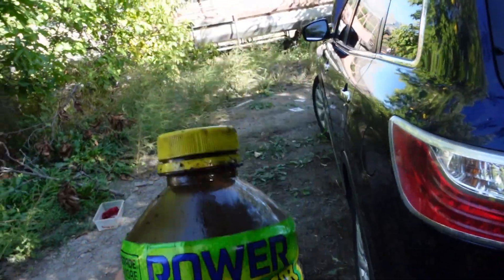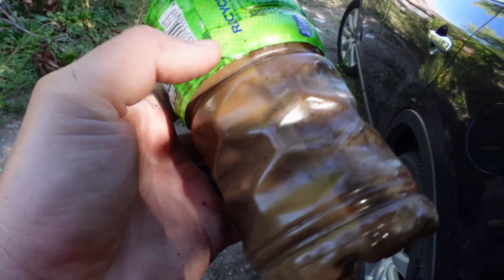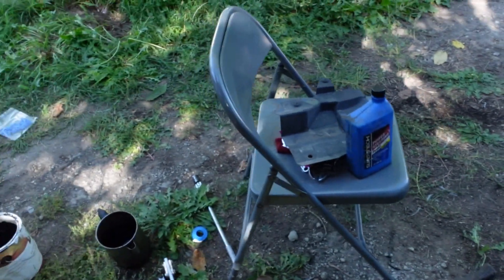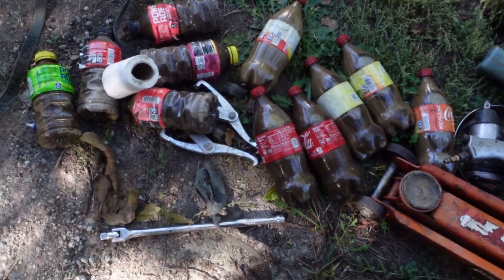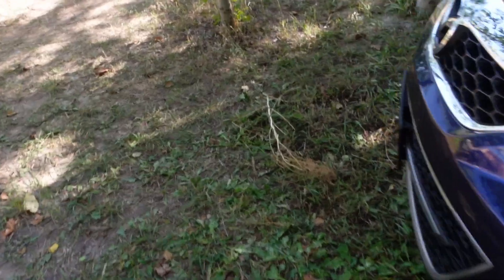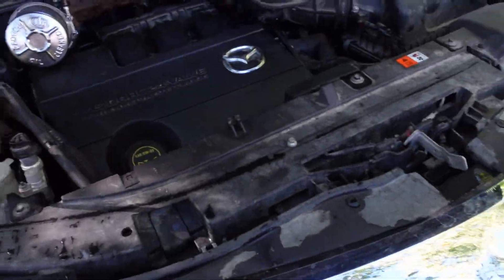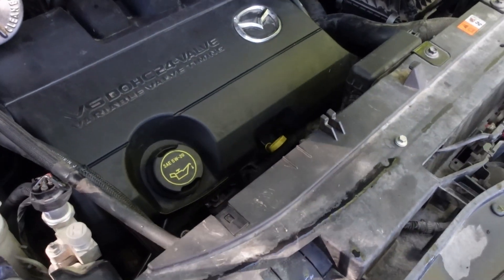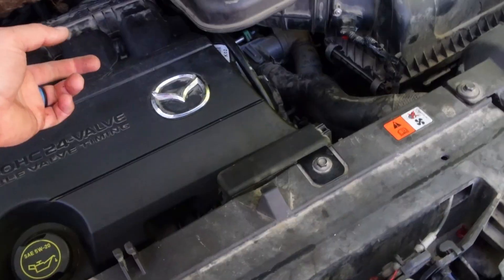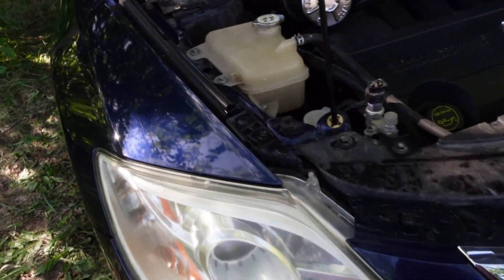The first thing I did was drain the oil. This is what the oil looked like — like a milkshake. Not only that, there were 12 quarts of it in there because it was taking the water out of the engine and putting it in with the oil. I'm surprised it didn't hydro-lock, because you had that milkshake all the way up into the intake manifold, which we cleaned out.